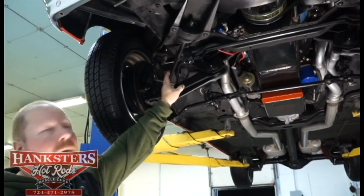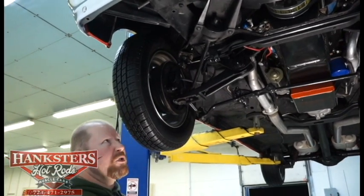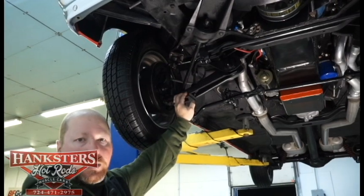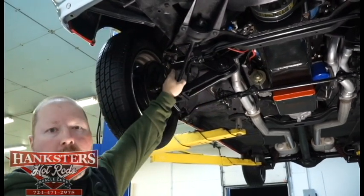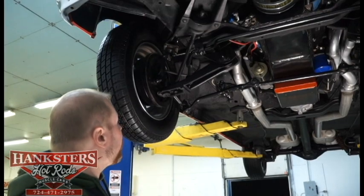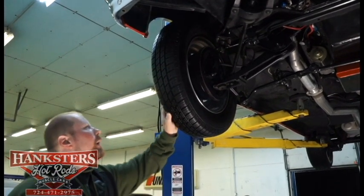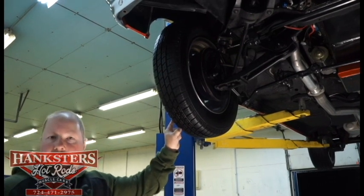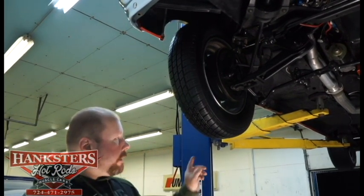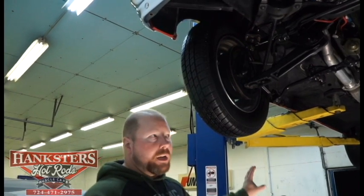On the Novas you had this strut rod front suspension — that's all intact, and the bushings are in excellent shape, no splits or cracks, they look to be all-new. The front suspension is all stock stamped components: stock lower control arms, stock upper A-arms, shocks and springs — all just standard front suspension. As far as wheels, we've got those 15-inch Weld racing aluminum wheels. We've got 165/80R15 tires on the front — they've gone with a narrower tire up front and a wider one on the back to get more meat where the power transfers to the road, giving you lots of grip back there.